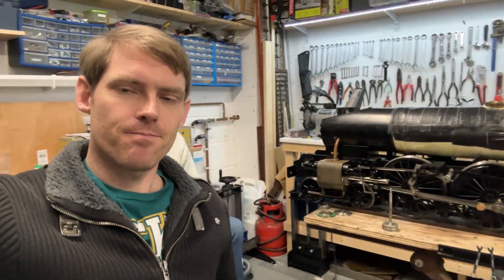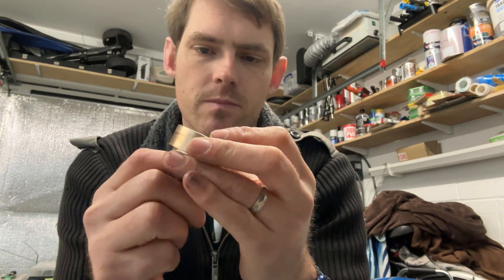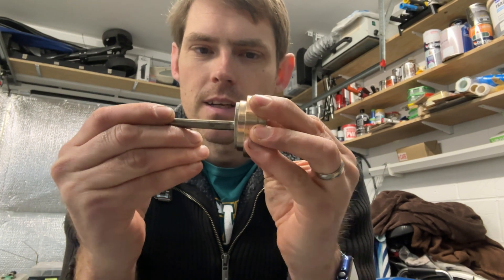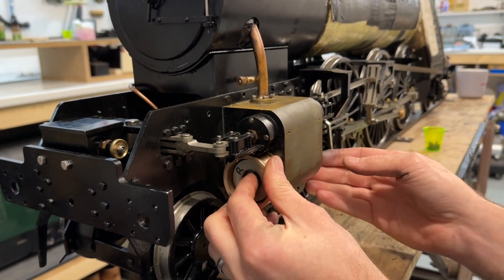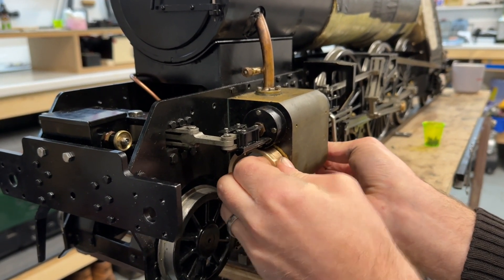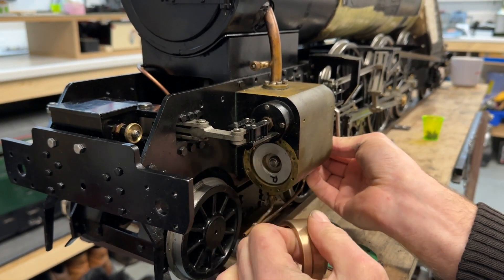I've now come down to Mike's — here's Mike — with the engine, the collar, and let's see how it works. The intention was with that taper I showed you: as it goes in, it will sit in the end of the cylinder and the taper inside will close the rings up, and it will just push through and stay in the cylinder. That's the plan — let's see if it works. There we go — it caught somewhere and then went through.